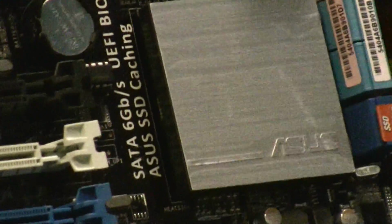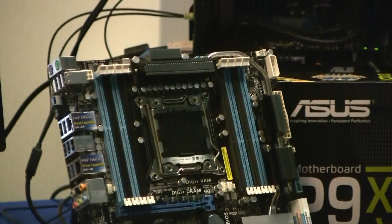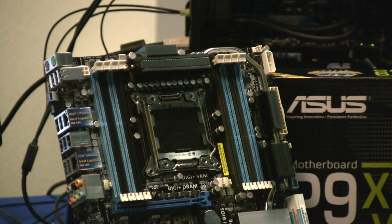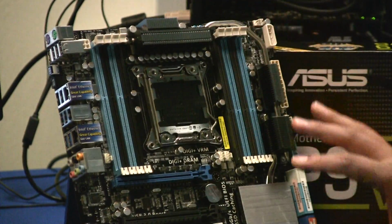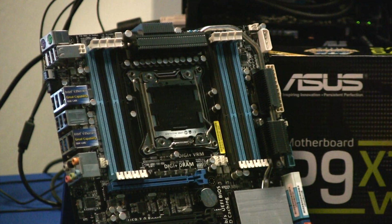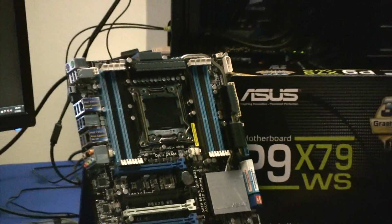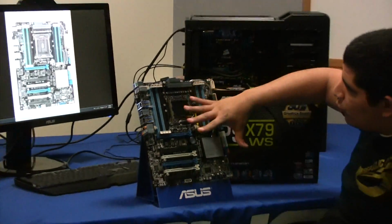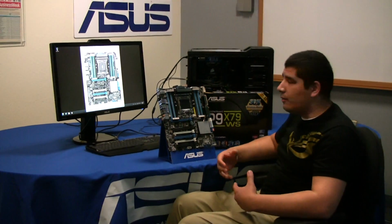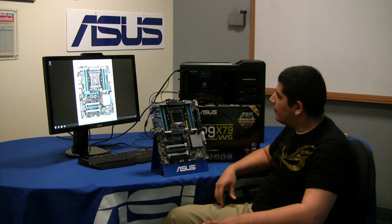And this really works well, especially in these optimal configurations where when you're heavily overclocking the system, when you're pushing past 4.5, 4.6 gigahertz, you want to make sure this VRM is adequately cooled. So not only have we provided a very robust cooling solution, but when used in conjunction with a chassis like this, where you have downward firing fans that can actively cool this, you're really helping to extend the overall efficiency and the power delivery of the VRM to help solidify those higher level overclocks if your CPU is able to hold out.